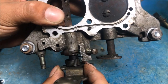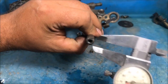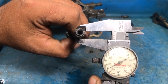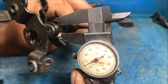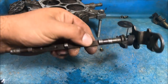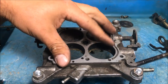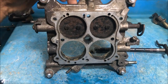Using too heavy a spring will also wear it out — I actually have a real heavy spring on my Chevelle right now. The first thing is to mic the part of the shaft that's been riding on the aluminum to check for consistent wear. We get 0.365 all the way across — throttle cable side, 0.365 — so the shaft is not worn at all. They sell these shafts for around $20, but you usually don't need one unless it's actually bent. The problem is the base plate — I never see just the base plate for sale; they always want to sell the whole thing for around $120.